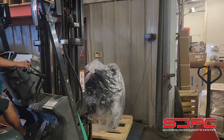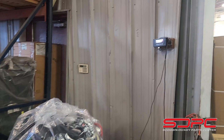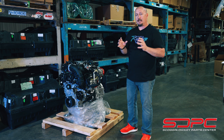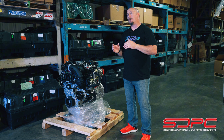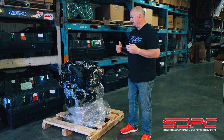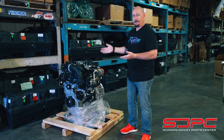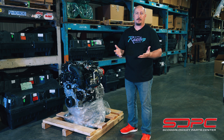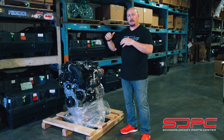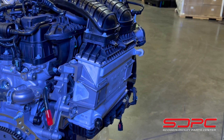This is a really nice, condensed, and lightweight package — roughly 70 pounds lighter than your 5.7 or 6.4 Hemi, which have cast iron blocks accounting for a lot of that weight. For those who've followed the BMW and Toyota Supra inline-6 turbo lineups, some of this will look familiar — it's OEM stuff that works well. Unlike the EcoBoost's air-to-air intercooler, this is water-to-air intercooled, with a water-to-air intercooler stack on the side.